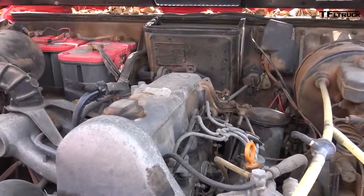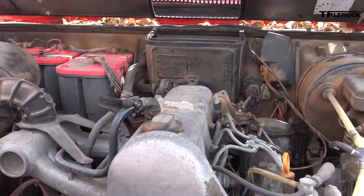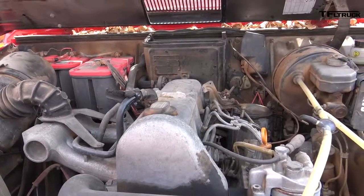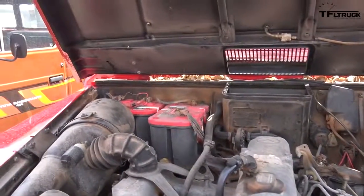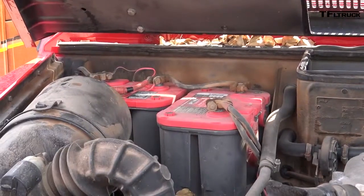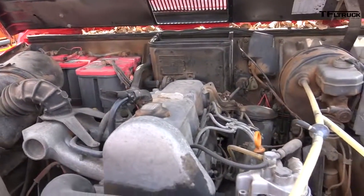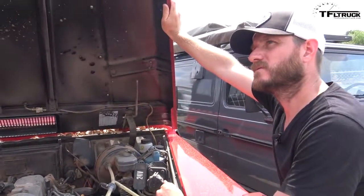And do these two trucks still have the original engine, or do you swap? They still have the original engine. Let's see what those look like. Yeah, let's swap. So now it has a regular 240 4-cylinder diesel, naturally aspirated, 87 horsepower. Got about 140 foot-pounds of torque. Yeah, 24 volt. So when this goes to a 5-cylinder turbo, the whole system will be gutted and go to 12 volts. 24 volts because it was a military vehicle.